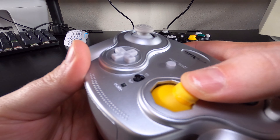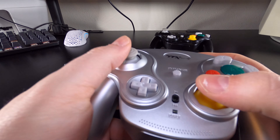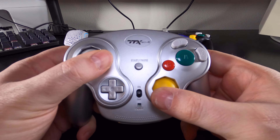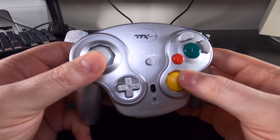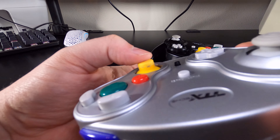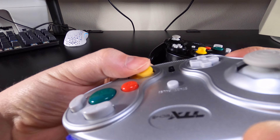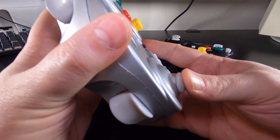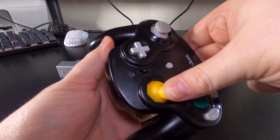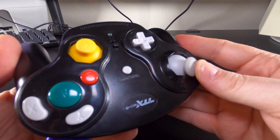The biggest issue I have with the WaveDash's quality though comes from its analog sticks. Here's what's weird — the quality varies between units. The black WaveDash I received is vastly better than the Platinum one. If you rotate the thumbsticks, you will see that they begin to rub against the gate of the controller in an improper way. The C-stick hits fine along the bottom left, but scrapes on the upper right as you can see from the discolorations here. The main analog stick scrapes the underside of the thumb pad in every direction pressed, keeping it from hitting its full range. On the black WaveDash, these problems are significantly reduced with the C-stick having no issues and the main stick only scraping on the right side.